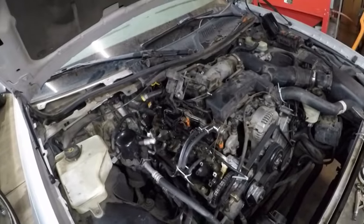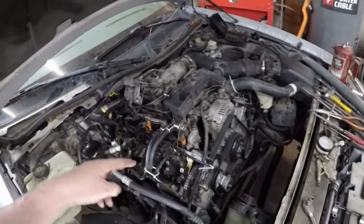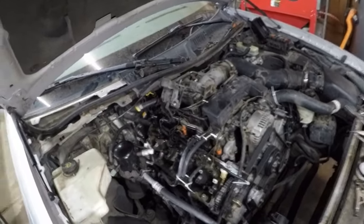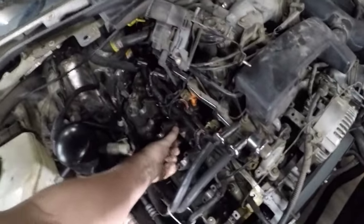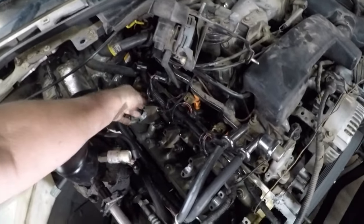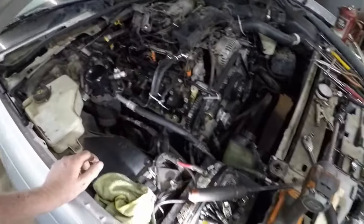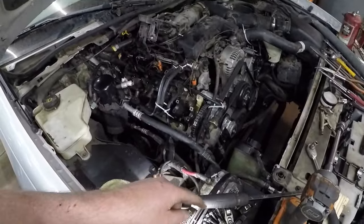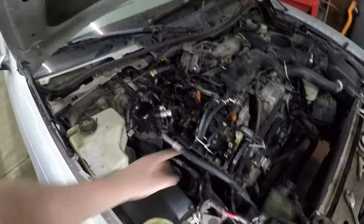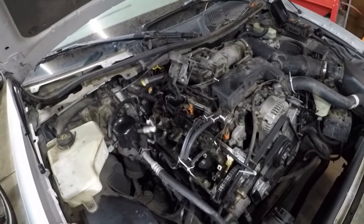So that's when I thought, okay, something's going on. Like I say, I brought the lifters back up because these are all solid now. They're nice and solid because they were completely collapsed. There was no oil in them. Now they're back up. These two are a little soft, but they could be soft because I still haven't oiled them and pumped them up, but those are all good. But that's when I thought, no, something is going on.